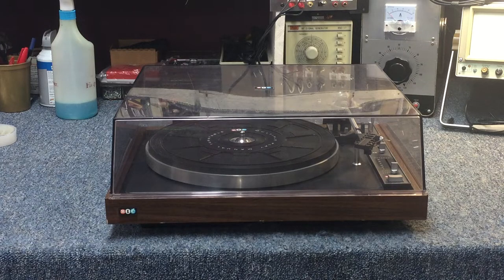I didn't even bother hooking it up, but it does have the head shell, which is a good thing. There's no cartridge in it, but it does have a P-mount cartridge holder already installed. Didn't find the automatic record changer spindle, but there is the single spindle. When I pulled that out, I could tell that somebody had been digging around where that E-clip is that holds on the platter. The E-clip is not there, and the platter is frozen in place — real stiff to move. That may have been one of the contributing factors as to why it was even in the shop. We have no date, can't track it back, have no idea how long it's been there. I'd say multiple years.